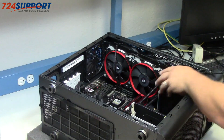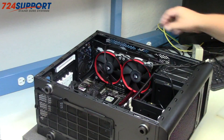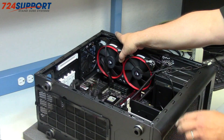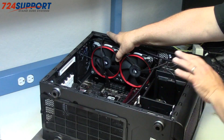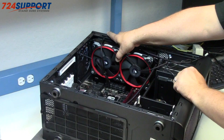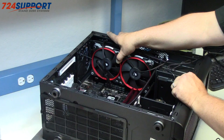Now we have an Asus DVD burner and a push-pull H100 with the Scythe Slim fan. It's going to make it hard to keep the system positive pressure with that much exhaust — I'm going to have one, two, three, four, five 120mm fans pulling air out, and one, two, maybe three or four 140mm fans pushing air in.